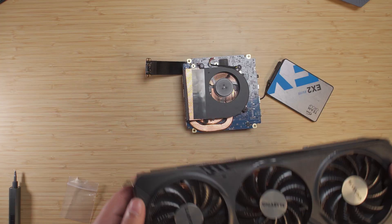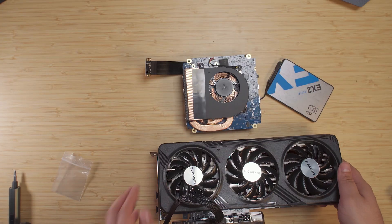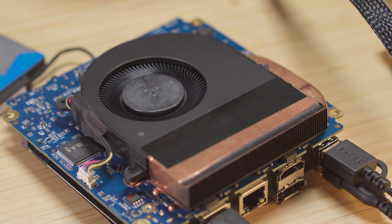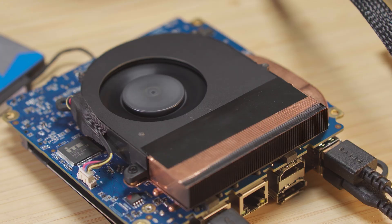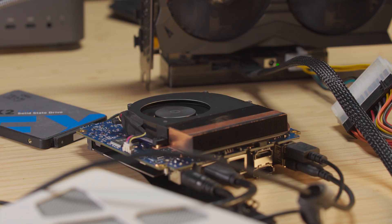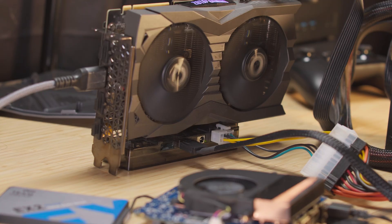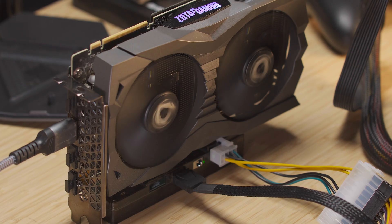As for the Oculink GPU, it is going to be the RX 7600 XT. It took a lot longer to get this up and running than I had originally anticipated. I ran into an odd issue where the driver for the graphics card just would not install properly and there was not really anything I could do. Eventually, what fixed my problem was just swapping over from the RX 7600 XT to the RTX 2070 Super. Almost all the issues I've ever had with Oculink have been solved by just switching from AMD to Nvidia, so I managed to get it working with the RTX 2070 Super pretty much immediately — that's what I used for testing.